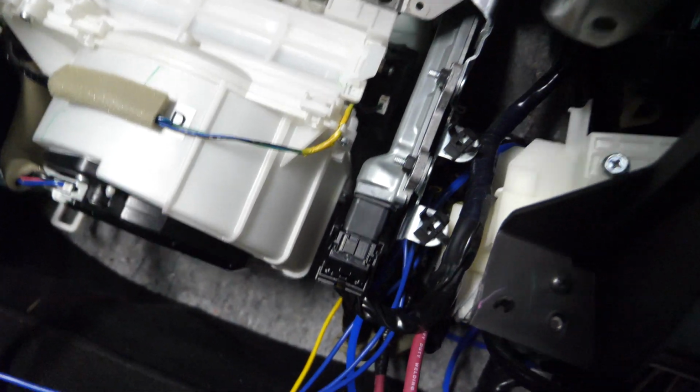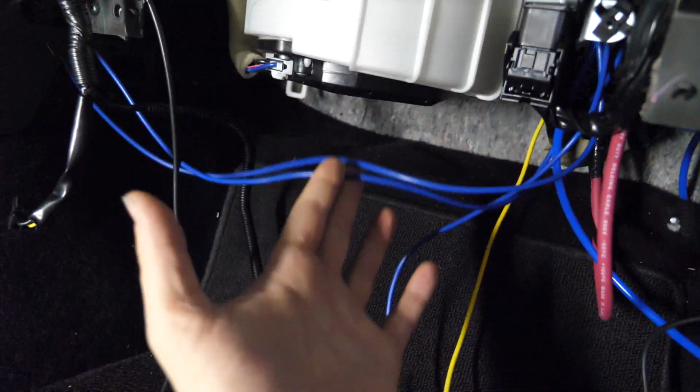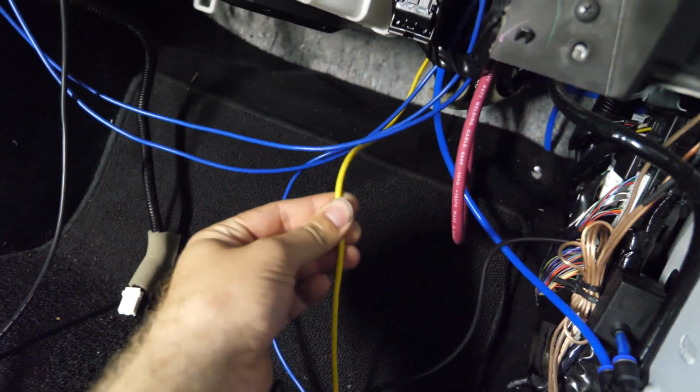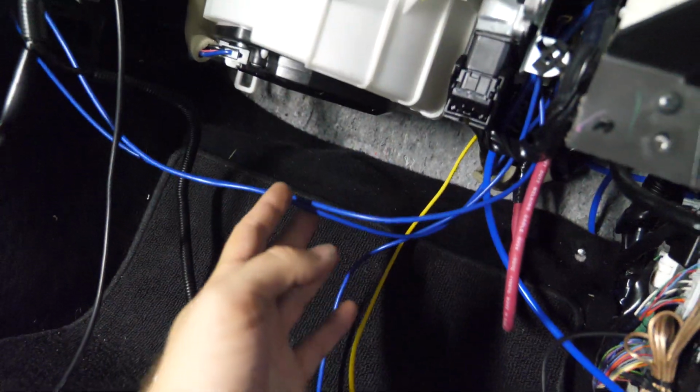So the ECU is back in place, the relay box sitting on the back of it. I'll try and get a better picture of it for you with the lighting here. But we've got those 2 additional wires going to our new fuel pumps. We'll tuck this wiring away up in a second. We fanned out the trigger wire here to be able to go to all 3 of those relays. So that's pretty much set. Again, we'll clean up the wiring in a second.